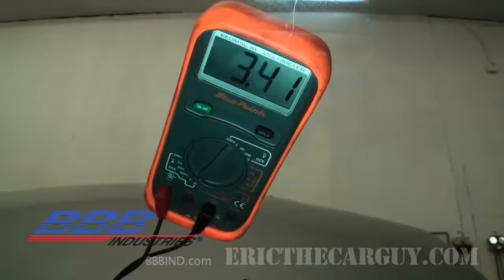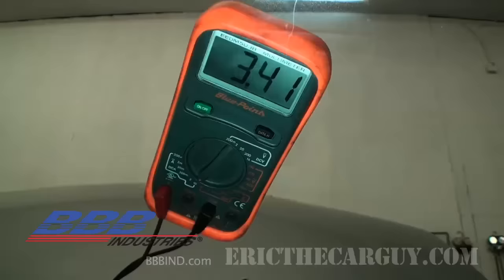Make sure you push fuses all the way back in. There — found it! Significant drop in amps; we've found the affected circuit. Now it's time to see what's on that circuit. I just pulled this 10-amp fuse from this slot — it's labeled 10-amp accessory: interior light, radio. So I know the circuit involves the interior light and radio, and I'll pull the wiring diagram for this vehicle for that particular fuse and go through both what appears to be the radio and interior light to see all the things involved in that circuit.